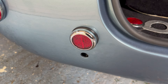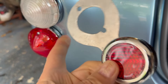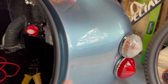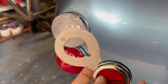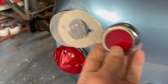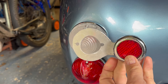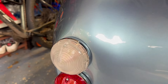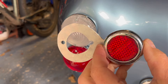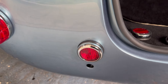If I wasn't having jacklifters or nudge bars I'd probably do that permanently. The other solution - since I am having jacklifters and didn't want to fit these just yet - is to make a little aluminium template that fits behind one of these lights and sits next to it. You can hardly see the bracket when it's fitted and it looks really quite cool. That's another solution for something more permanently fitted.